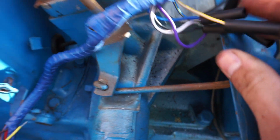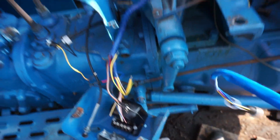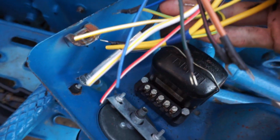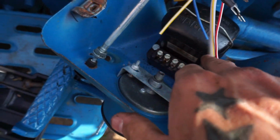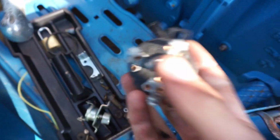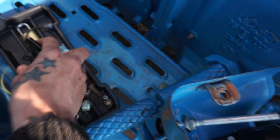These ones here are plugs, but I've already brought a separate bit of one of these into these wires here, and this is a separate bit, and then in here you have a red and green light bulb, as I said, which come up here for your oil pressure, and I think one's for your dyno charging. And then down here, all these need cutting, trimming, soldering, and they're just all going to go into the fuse box, heater plug, and of course your ignition, which also, if you wanted to, has the light switch on as well.